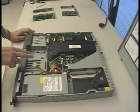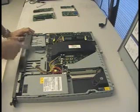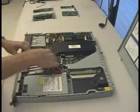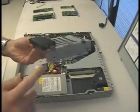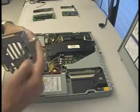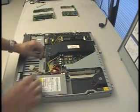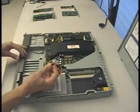Up in the front, we have two bays. Each of them are 3.5-inch drive bays, normal for a SATA, IDE, or a SCSI drive. Each one of them is called a sled, and they are screwed in. There's nothing in it, so I'll just go ahead and unscrew it and show you what it looks like. Up on the front, we have where usually a floppy drive would be connected, and on each side we've got the four screw holes where you could put in a drive. It has its own IDE interface, its own IDE cable, and also its own Molex power.